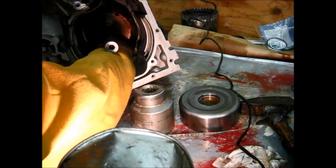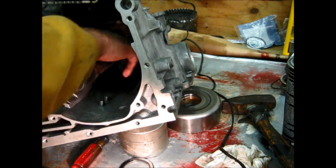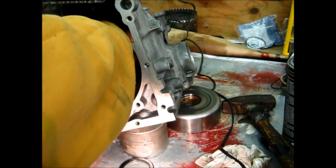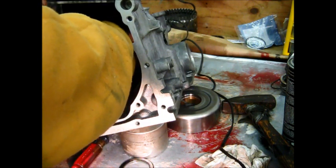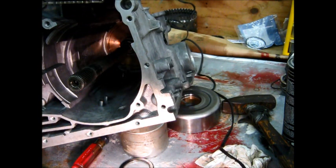You can start the snap ring by hand and then lock it in with a screwdriver. I couldn't really video the snap ring going in because I was blocking the camera — it's pretty much done by feel. But it's in there now, so that part is done. It turns freely, and the park lock is working. One step closer.